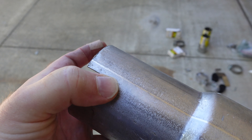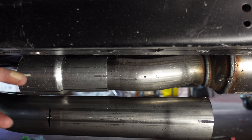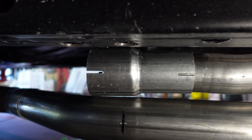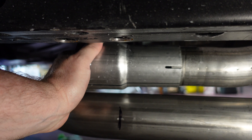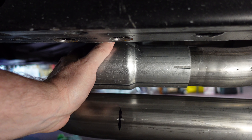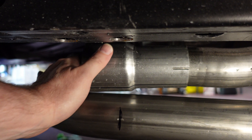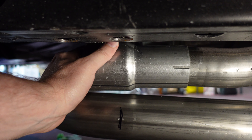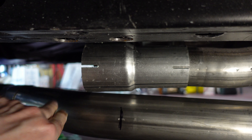The cats have a little bung on them that's going to get in the way for sliding the reducer on — I may have to grind that off because it's going to interfere with the clamp. Looking at it now, it's right up at the edge. I think I'll grind that off to give me a little more room to work with — going to fire up the compressor.